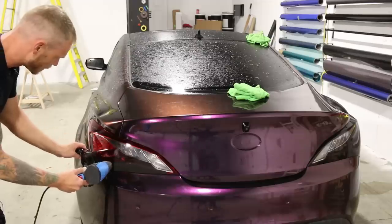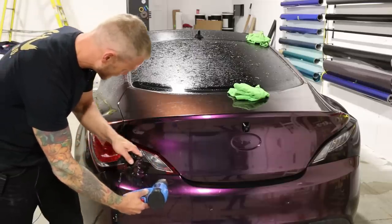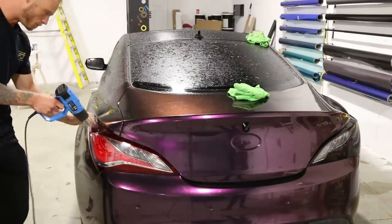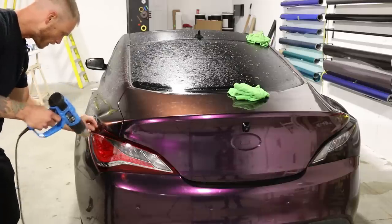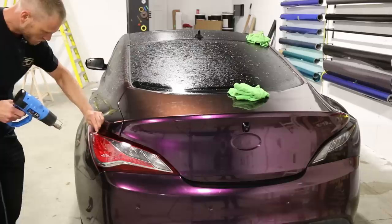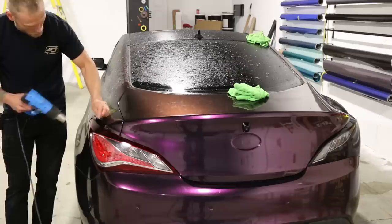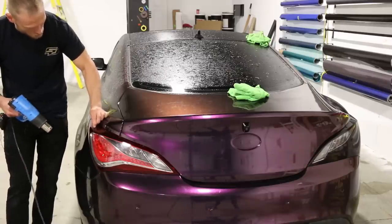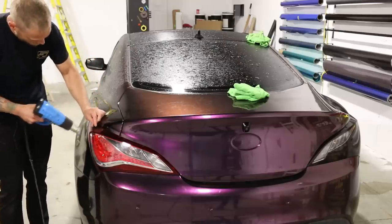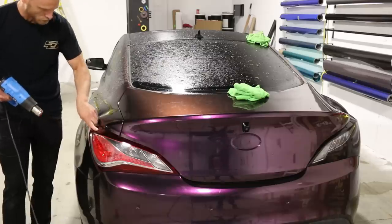You can see the face is much more intact — coming off really, really nicely. I haven't seen these in so long. You can see my crack all the way through there. I've got a couple of extra bits on top here, so again we'll just add a bit of heat. Keep your heat gun moving — don't want to burn yourself or the actual light. The little bits being left behind is a very common problem with any film, especially on horizontal surfaces when the sun is beating down on it — it's going to dry it out. This is why you see the color fade on the top. It's coming off nicely with just a tiny bit of glue — nothing that a little goo gone won't be able to take off. Maybe some isopropyl, just be a little bit careful that it's not too strong.